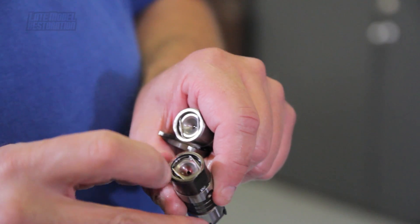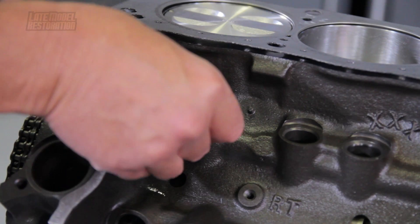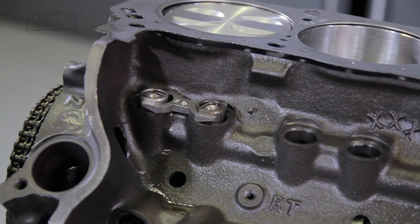To get started, apply a small amount of oil to the lifters. Install the lifters into the engine block with the holes facing up and toward the center of the engine. Position one of the lifter retainers between the lifters in their marked orientation — these are also referred to as dog bones.